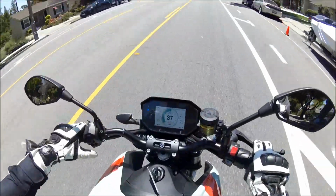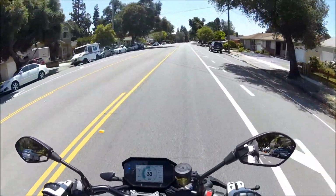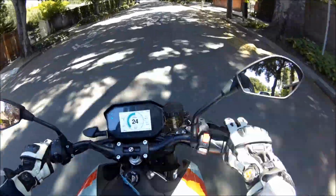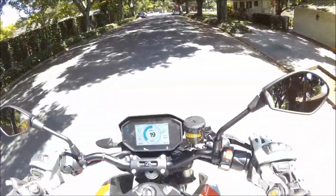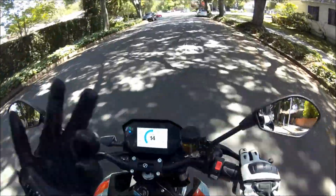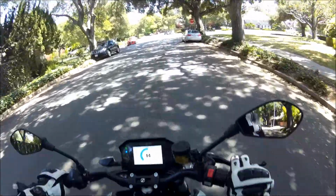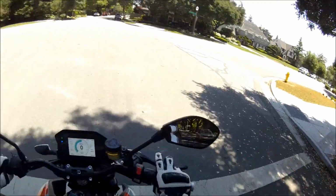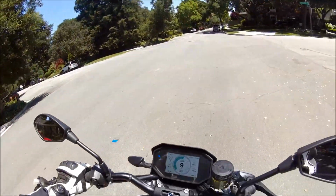So I think that's how it works on this Zero bike and all the Zero bikes. So listen very carefully. When I let go of the throttle and I give it, there you go. See, you can hear it. It gets a little louder. It regens a little bit more. It doesn't do it until you give it a little bit of brake. So you can kind of tell it how much regen to do.